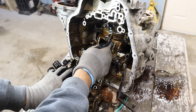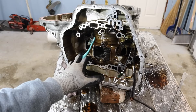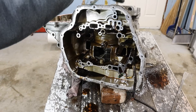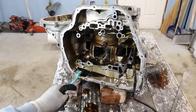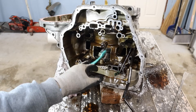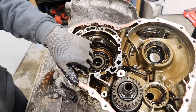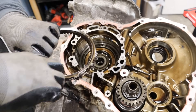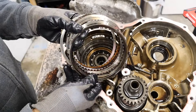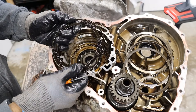This here is the sensor, which is likely a speed sensor. I'm going to move this sensor. Taking a look inside the valve body: these two big holes are the ones that go to and from the fluid pump that sits on the front of the transmission. All these little ports here are ports that go to either the clutches or to the variators themselves to fill them up and change the gear ratio. Now that sensor's out of the way, we can grab the next set of clutches. Those are the piston return springs.